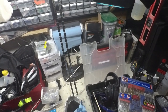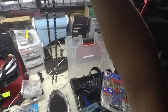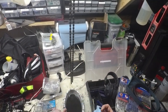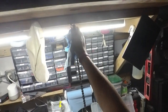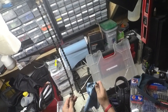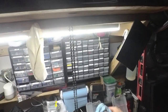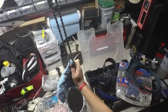Don't have the daylight anymore, so it's a little harder to see this as it's backlit, but still nice and shiny, just like it was before. I broke my chopstick. We're just trying to get the excess wax off of here. It's okay if you leave it on, but then it's going to be really stiff after it's cooled when you go to put the chain on. You'll have to kind of break it all down — it'll leave extra wax on your cogs until that wears off. So after doing this a few times, I just prefer to wipe it down.